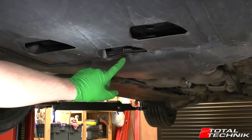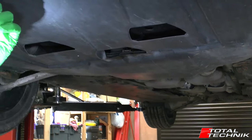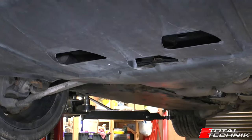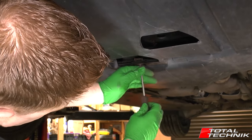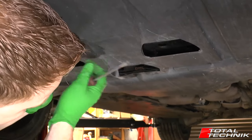I've left the final screw at the back centre in place — that's going to be the last one out. The front holds itself in place because it's stuck up behind the lip of the bumper, so when you remove that last one the whole thing will want to fall down. Get yourself positioned underneath it and carefully drop that one down like so.